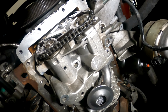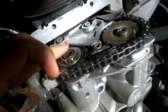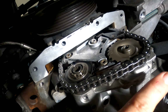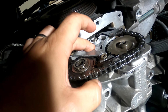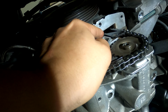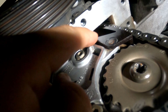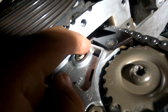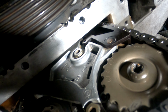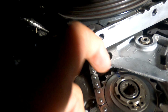Well, we're cooking right along here. I got the pump back in and then I struggled to get the tensioner and chain on. So I ended up loosening the pump hardware so it could slide a little bit and then I could put this on. There's a tiny hole right here that, once you collapse the spring and tensioner, you put a little pin in there, and that held it in the collapsed state so that you could put everything back together.